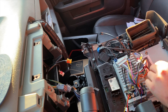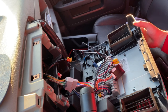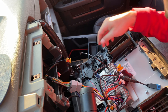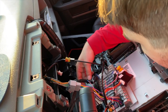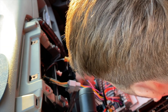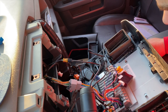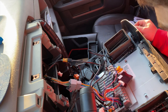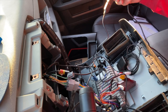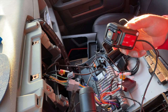We have a lot of wires here to figure out, so the main harness connects to this connector inside. We've got the stock antenna right here, and the antenna wires connect accordingly. I'm going to run the USB extension so that it reaches out to the glove box. If you bought the DVR with your radio, it just gets plugged into one of the USBs — I'll route that to the glove box later. This is the dash cam DVR that's an option to purchase.